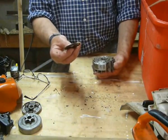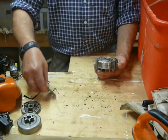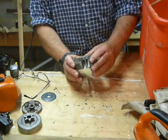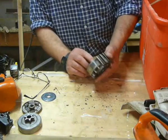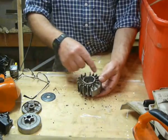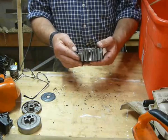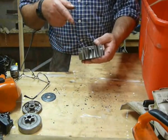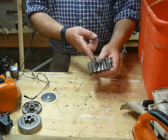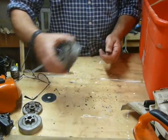That's the oil pump guard, I think. That goes underneath there. This is the flywheel, and the Woodruff key is still in there. The flywheel's got no fins missing, which is a good indicator — because you can get idiots who put a screwdriver or something in there to lock the crank so they can undo the flywheel nut, and of course it just breaks the fin off and then everything's out of balance.